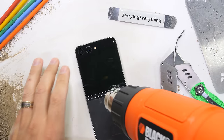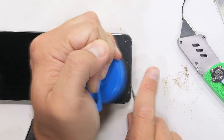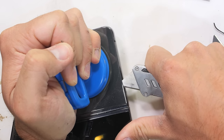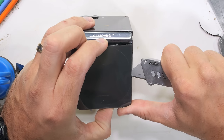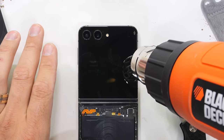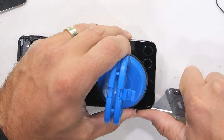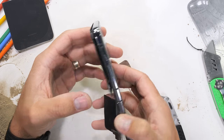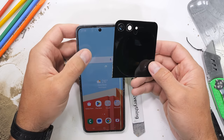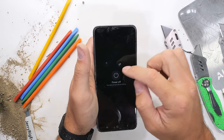The direction a normal person would initiate disassembly is through the back of the phone, going through the bare glass panel as well as through the flex window display screen. I use heat and a suction cup to lift up the glass from the frame. The glass is nestled down into the frame walls, so it's fairly difficult to extract. There seems to be less adhesive around the left and right sides of the glass, and my JerryRig razor knife can work its slicing magic from there. With the rear glass gone, we can move up to the flex window, taking very special care not to accidentally poke the AMOLED panel underneath the glass, since it's about as fragile as a potato chip. Before going any farther, I want to see if the phone is still alive after having completed the two most difficult parts. Both screens look good — we might still be on track for success. I'll get everything powered down as we continue excavations for the battery.